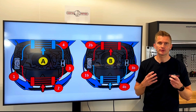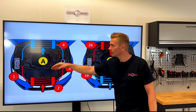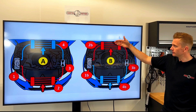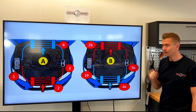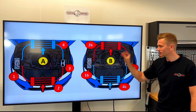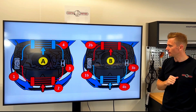It's very important that you know how to repair a system with a heat pump. On a normal air conditioning system we have the heat at the condenser and the cold at the evaporator, and when it's running in heat pump mode it actually works the opposite way — we now have the heat inside of the cabin and the cold outside. But to make this function we need some extra components. It's not just the air conditioning compressor turning the opposite way because they often use a scroll compressor, and the scroll compressor can only turn one way. So we need some extra valves and some extra pipes.